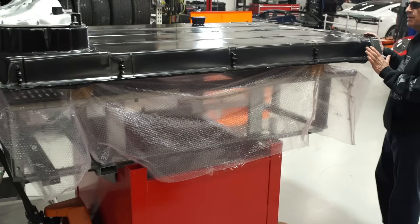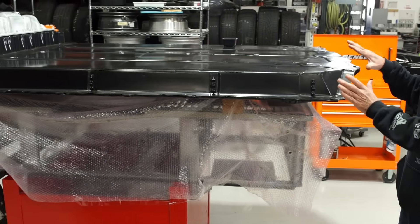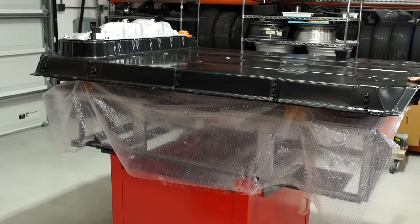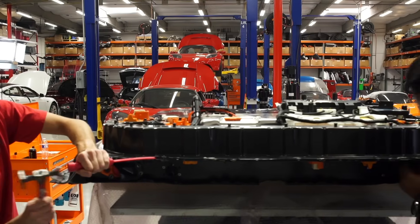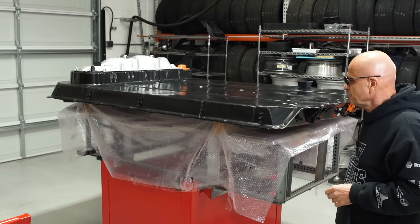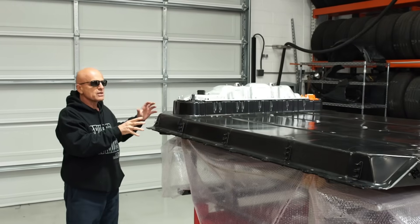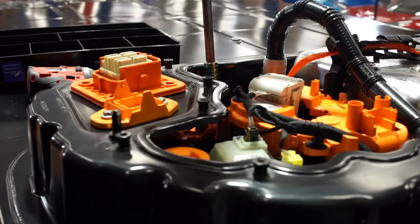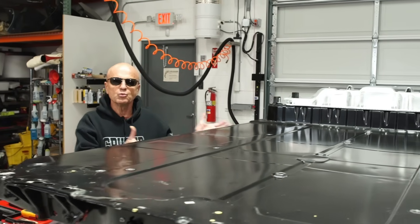When these battery packs are remanufactured at Tesla in Lathrop, California, they take these lids off of Model S, X, or 3 batteries and it's usually a destructive process. We have to take quite a bit more time to remove this lid because we don't get a replacement lid from Tesla — in Lathrop they simply have new ones. Once we remove this lid, it will expose all the battery modules inside the pack and we can begin to isolate what's wrong, whether it's in the battery management system, the electronics, the logic, or a parasitic or dying cell in one of the modules.